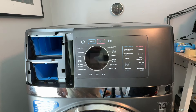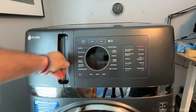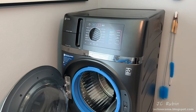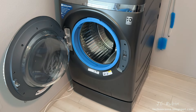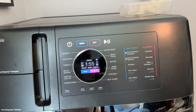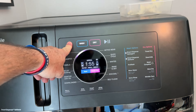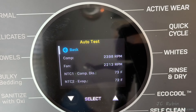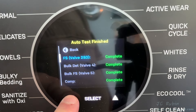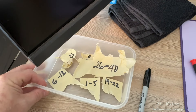Fully assembled — installing the dispensers, detergent, and fabric softener, plus the filter. Hot and cold water is turned back on, the machine is moved back into operating position, and we plug in power. Conducting a quick electronics test — kind of funny, the first thing that happens is we get a filter notification. I shut down the machine, run some diagnostics, and make sure everything's okay. Main focus was the heat pump — everything operating very nicely, numbers were good, no strange noises. The results of all tests show no errors. The tape method kept all the screws in order and made this job really simple.